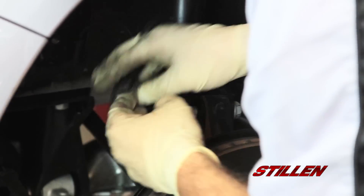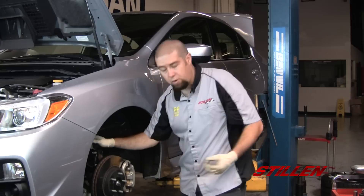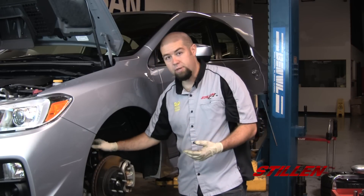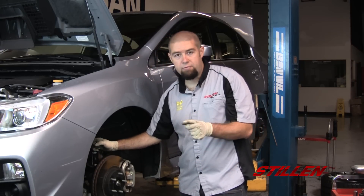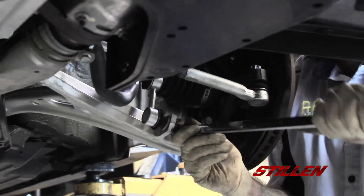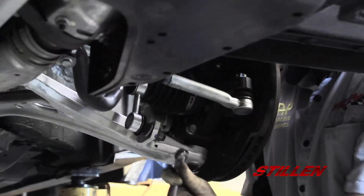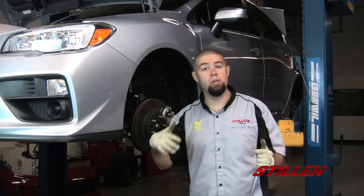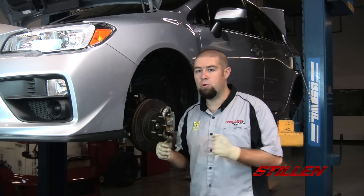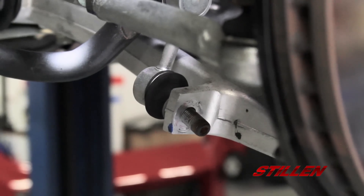There's a little trick to the ABS sensor. The clips themselves are a little bit difficult to get to if you don't have the special tool. Just give yourself a little bit of time — make sure that you get just enough grip on the clips themselves and then just slowly twist out. A little trick to keep in mind is that it's really easier to work on any sort of suspension once you remove that sway bar. The sway bar is going to preload the suspension and make it a little bit more difficult, keeping all the nuts and bolts a little bit tighter. So if you remove the sway bar, it gets rid of a lot of that extra stress.